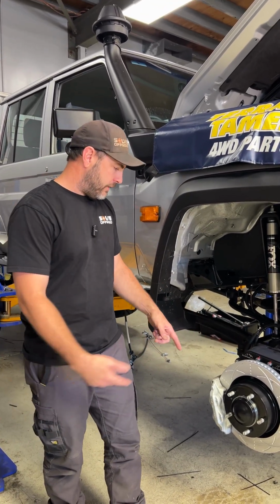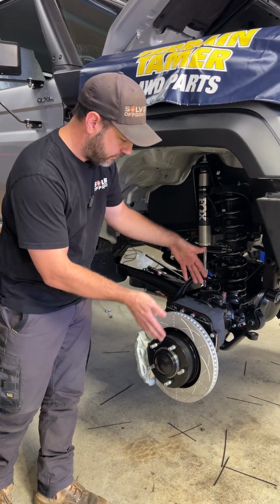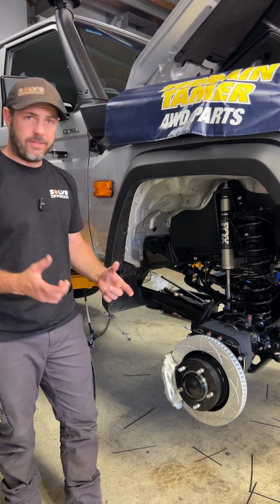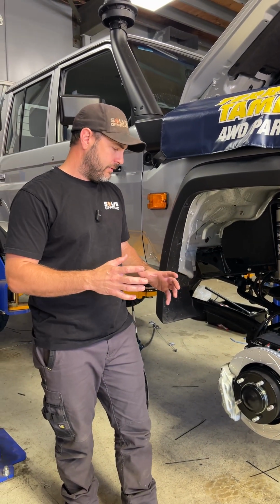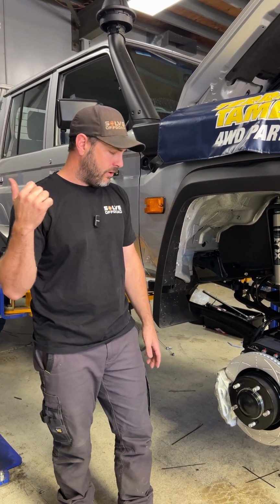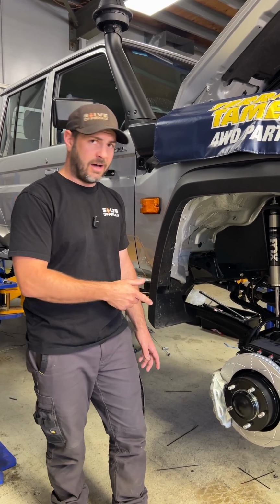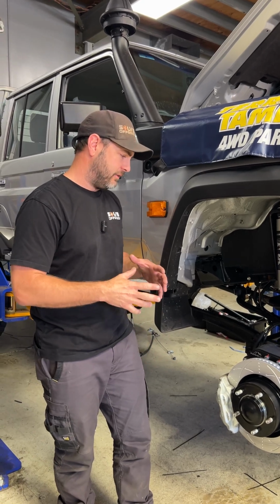As we move further in, the unit bearing design has allowed us to have a different axle. The lower axles in there are about the size of a Coke can, so they're no longer a point of weakness that some people thought they saw in the old sets. They weren't weak in the old ones, they were tough as nails for what they were and how they were built. These are probably tenfold that again, so just absolutely insane in the strength.